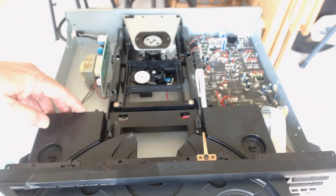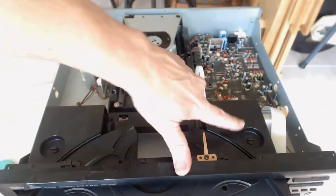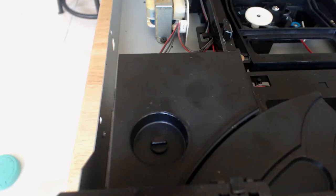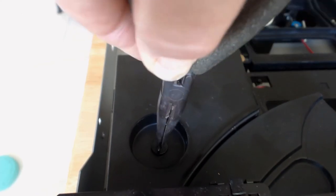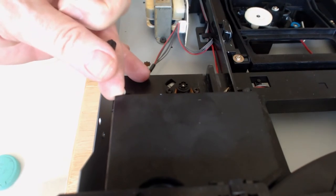This tray uses two little plastic quarter-turn stop pieces that actually prevent the tray from extending all the way. All that's required to move them is a pair of needle-nose pliers. Just take it and turn them 90 degrees and they pull straight out as you can see here. Once they're out, you can push the tray all the way forward and it comes right out of the unit.